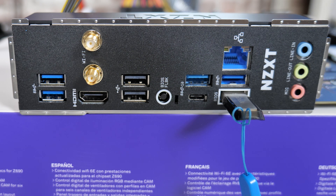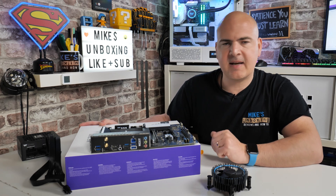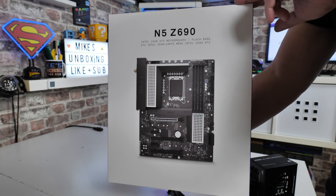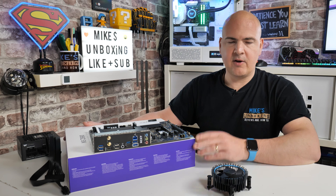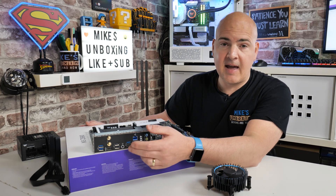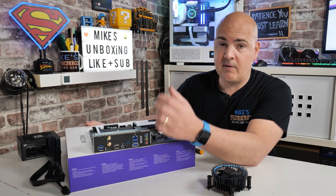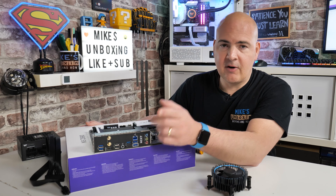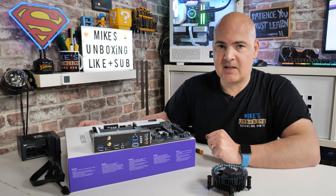The LED has now gone off, so that took about two minutes to flash, which sounds about right for a 16 megabyte flash. Normally a 32 megabyte flash takes somewhere between four to six minutes depending on the motherboard. So now you can shut down the PC and install your new processor. So there you go — that is how to flash the BIOS on your NZXT N5 Z690, or even some of the AMD boards, just changing out the BIOS file for the appropriate one for your motherboard. And as I said, if you plug in your drive, press the flash button, and just get a solid green LED, that means your flash drive is in GPT format. It does need to be MBR, and there will be a video link showing you how to convert a drive from GPT back to MBR so you can successfully flash your BIOS.